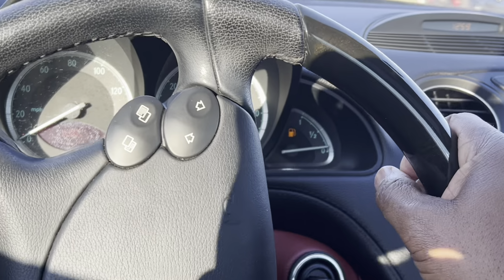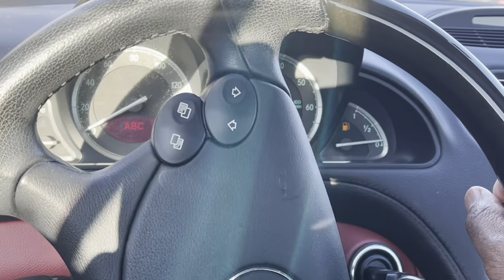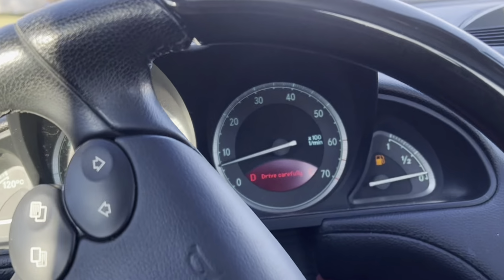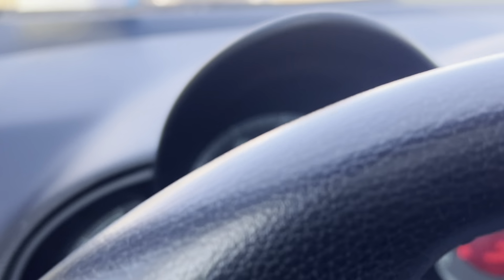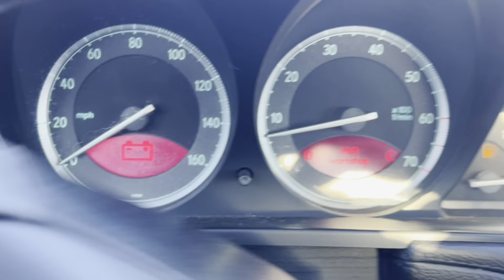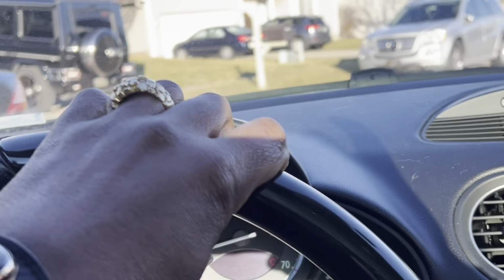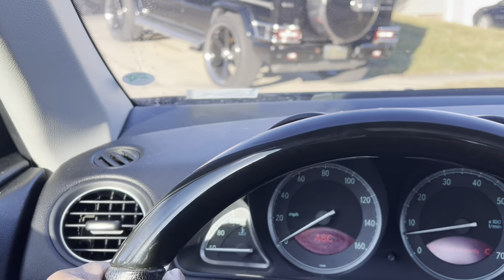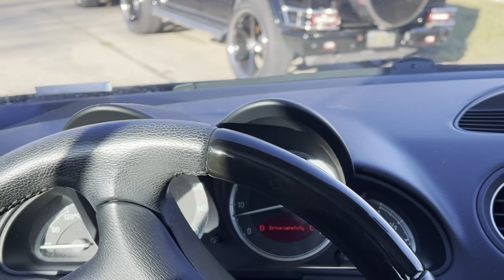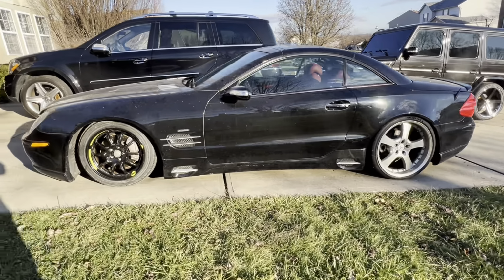So I think it's just the car not responding to the remote, because even the window didn't drop down when I unlocked it, which just means that your auxiliary battery is low. And that's what this indicator is telling me. It's so low that the locks will not unlock with the remote and the window would not drop down. But the starter battery is good. Obviously the car started.